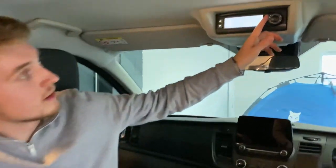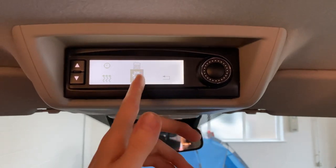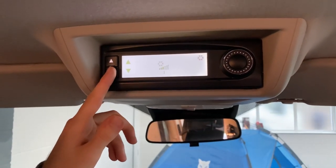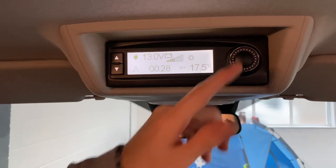As I was explaining the other features, you may have noticed this screen just behind me. This screen is how you control your water temperature, your heating and cooling and of course your refrigerator. It's very simple to use and there is an instruction manual delivered with every vehicle. As a rundown: to adjust the refrigerator, rotate the knob until the refrigerator button is highlighted, push the center of the dial and rotate the knob, then press the arrow keys up and down to control how cold you want your fridge. Press it again and you'll go back to the main menu. The same procedure applies for heating, cooling and water.